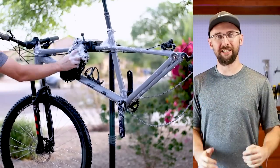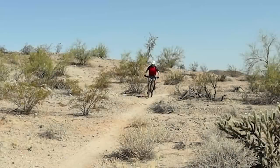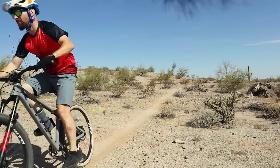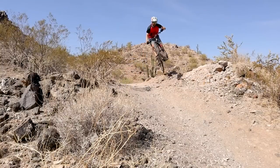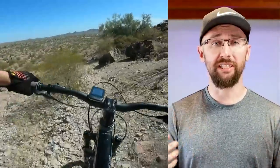This bike is fully race-ready now. There's only one thing left to do, and that's to go shred. Well, I'm back at the house, and it was definitely interesting to get back on a hardtail. I've just been so spoiled with the Mathique and all the high-quality parts. It definitely took some getting used to, especially with the budget Manitou forks — they really don't have much progression to the shock. They just feel kind of flat, and you can really tell it doesn't ramp up at all. Something that would help is if you could put in air tokens, but I don't think that's a feature on these forks. I didn't really notice much difference with the increased travel, but I did notice that my bars were much higher, and I actually stopped in the middle of the ride and adjusted my bars multiple times.